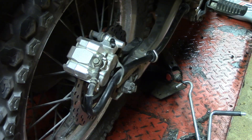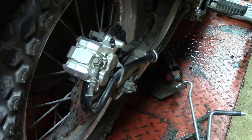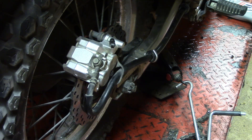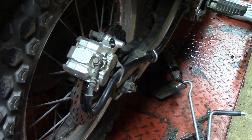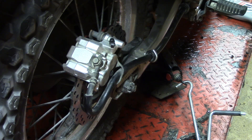One other thing I want to mention that I forgot to talk about: when I pushed the brake pad in to push the piston calipers in, the brake fluid went back to the brake fluid reservoir for the rear brake. So make sure you check that and make sure it's within spec and you have plenty of brake fluid. And make sure you press down on the brake pedal before you take off riding - make sure it has a hard, firm feel before you take off. It should be okay, but anyway thanks for watching - see you next time.